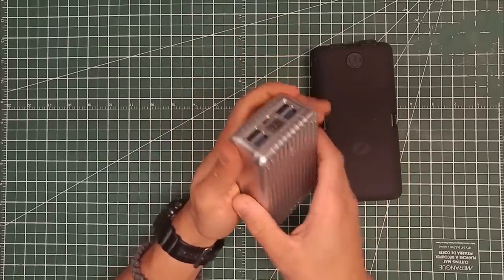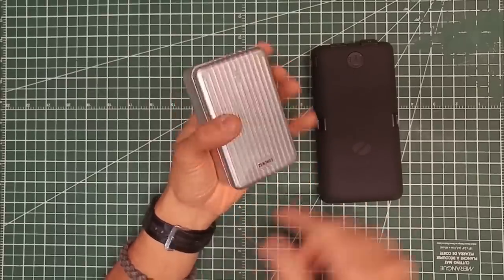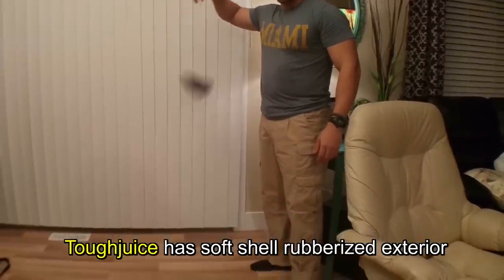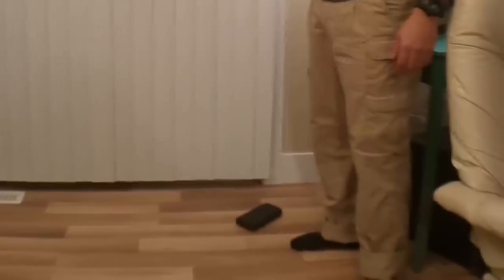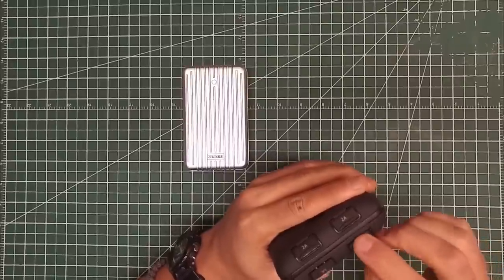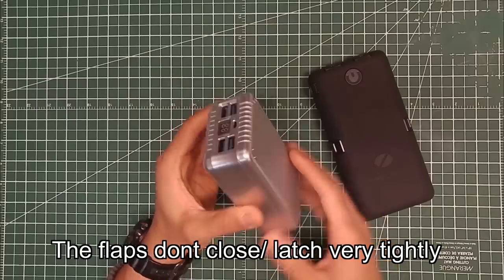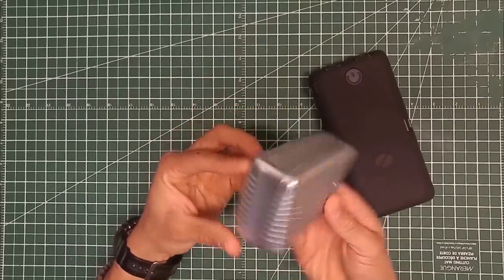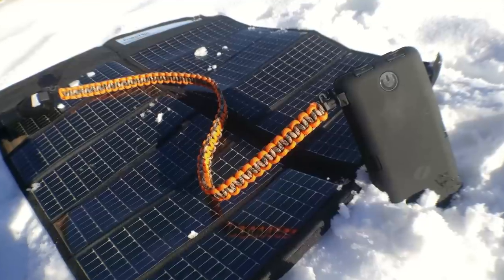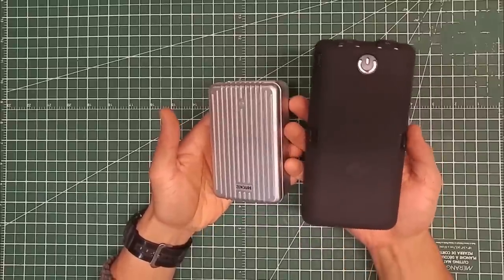One thing I really like about the Tuff Juice compared to the Zendure is the body construction. The Zendure has heat dissipation ridges and dual-layer silicone construction, but the Tuff Juice is just built tougher — also dual-layer, resistant to drops and bumps, and has more weather, dust, and potential water resistance. Although the port flaps don't have o-rings, they're still protective covers. I'm more confident in the exterior of this — it's a more rugged shell, though you do pay for that in weight, partly due to extra 18650 batteries contributing to the increased size.